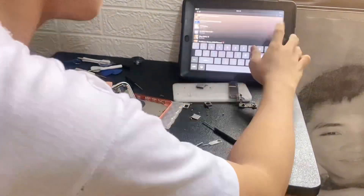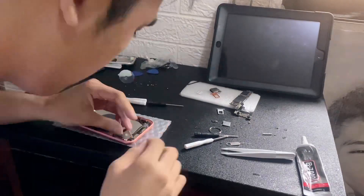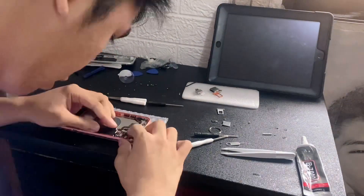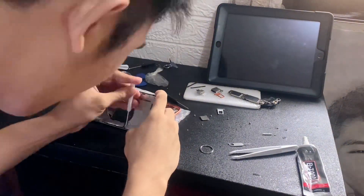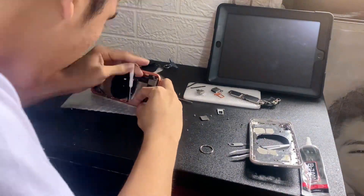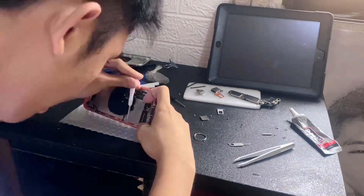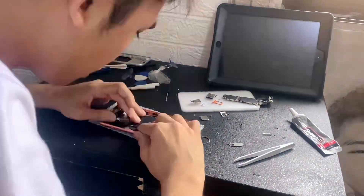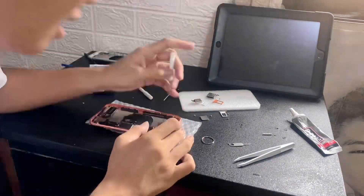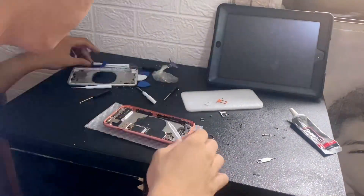The next thing to do is remove any components in the upper portion, including the antenna and the SIM card antenna — you need to remove those and transfer them to the new housing. After that, remove the wireless charging coil and transfer it to the new housing, because the wireless charging supports wireless charging functionality and you'll have full access if done successfully.